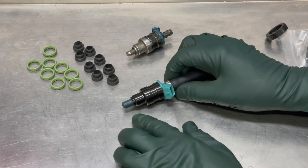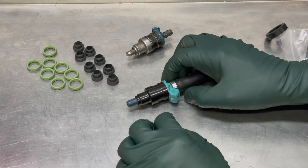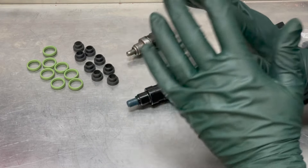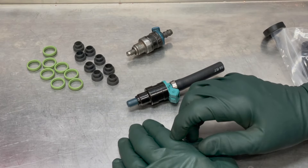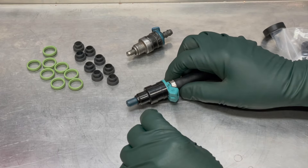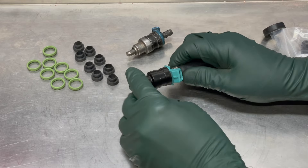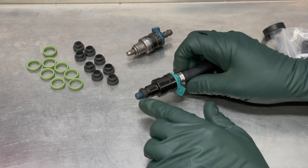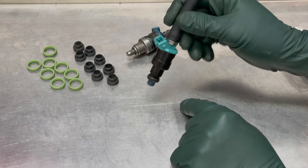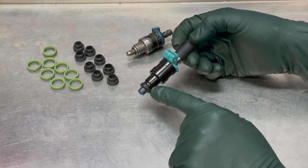What they did change is right down here at the tip. They probably changed it because they were having heat problems with the original seals — they were leaking air, which causes the engine to do all kinds of strange things. So on the early models from 1970 up through sometime in early 1974, this is the seal that was put on the injector, and then it was installed in the head, just like in my 300 SEL 4.5. That was it.